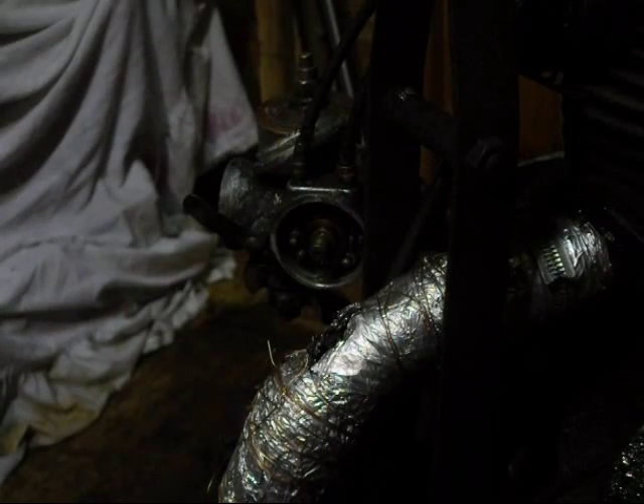You can see I can set the throttle to a fixed amount and let it run, but that's not great. So I either need to get another Sand Spray genuine throttle cable — and I need the whole unit, not just the lever. Or I might be able to substitute another Villiers throttle cable and mount another lever on the handlebars. It won't look right, but I'm not too worried about that.